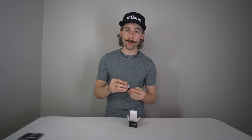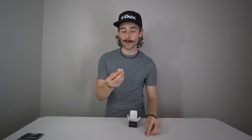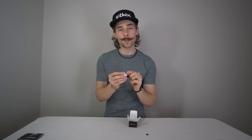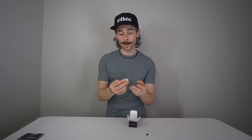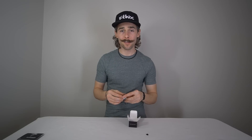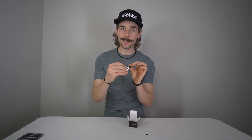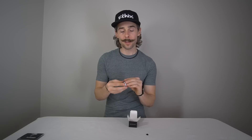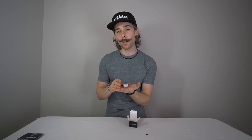Let's talk about the top of the motor. You have an 8mm nut that holds the propellers down. There are little grips here that hold the propeller in place in case your prop nut comes a bit loose. From my experience with a steel prop shaft, you don't really have problems with nuts coming loose if you tighten them sufficiently before takeoff. With the hollow steel shaft, this whole motor comes in at 28 grams — a super lightweight motor, especially for a 2306 stator.